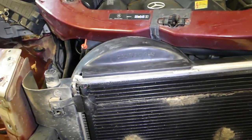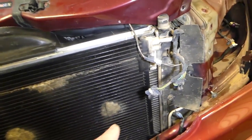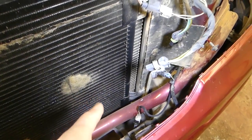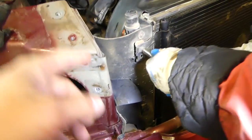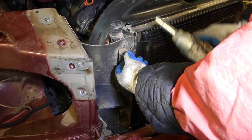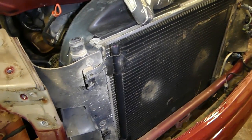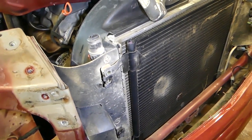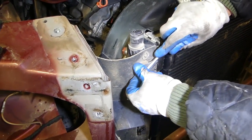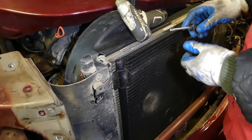Next, that's the condenser right here. There are a couple of bolts, but one of the lines is a little bit hard to get to. There is one bolt with a 10 millimeter socket or a wrench. We'll also need to remove that clip because it's holding here, just like we did on the other side. Make sure you don't lose those — you need them for later when you put it back together.